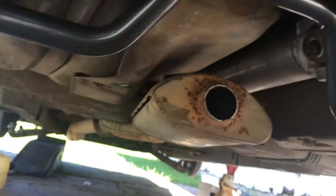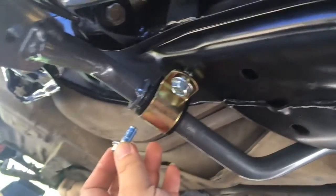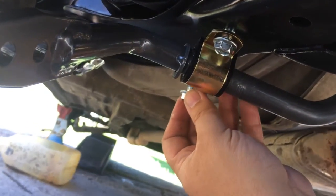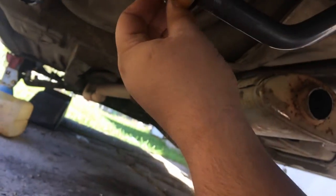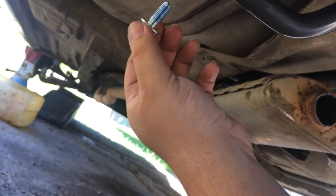All right, so what I did, I got the front bolt started, and then I worked over to the other side and got the other one started. It's a real pain to do by yourself, but I want to Loctite my bolts, and instead of making a mess trying to do it while I'm trying to balance this thing, I decided to start the first ones without the Loctite and then come back and put some Loctite on